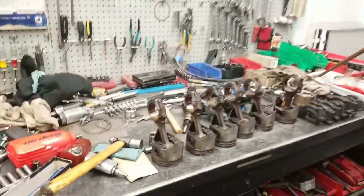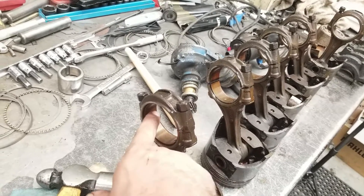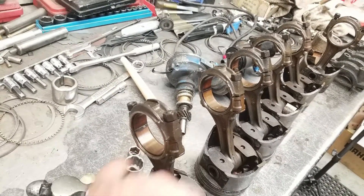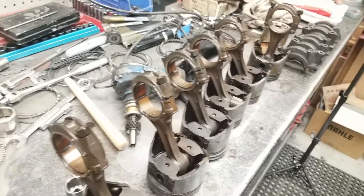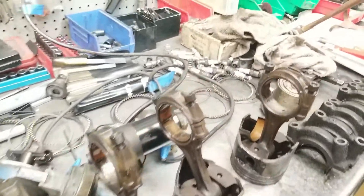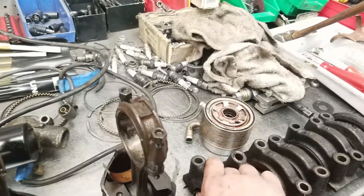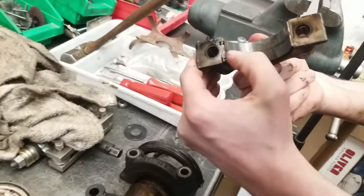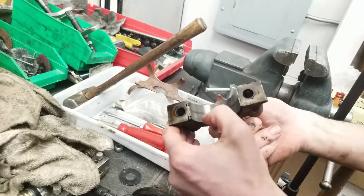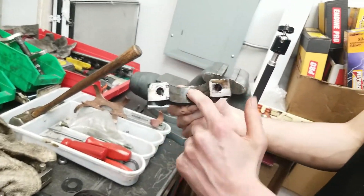Going over to the pistons — I was surprised to see the copper or brass bearings, which very well could be the original bearings. This motor has 169,000 miles on it, which is a surprising amount. What really surprised me though was how good the mains looked — really, really good. There was one main that had some kind of grit get caught up in there and wore a groove, but it looked like it barely scratched up the crank, so a very light polish would take care of it.